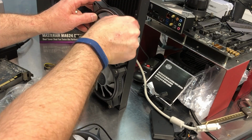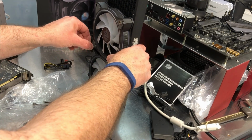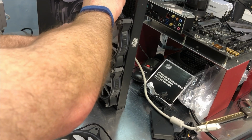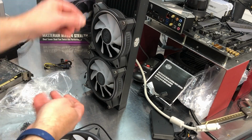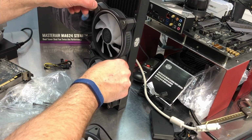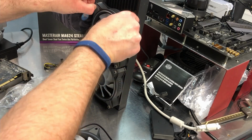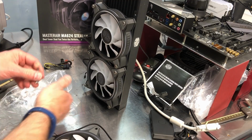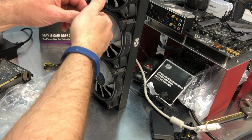And the first thing I do after I get the power to it, of course, I look at the thermals and make sure nothing's running away on me. Make sure I got the pump mounted properly, got the thermal paste all in the right amount in the right locations on top of the CPU. But the first thing I'll do to the fans is I'll run the fan tuning software, and what that'll do is it will look at the amount of voltage and current to run the fans at the minimum and the maximum RPM. You're sort of like calibrating the controls.